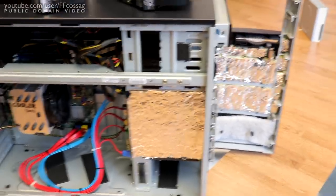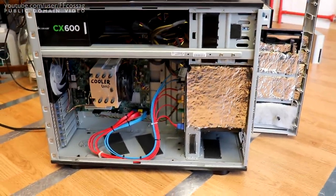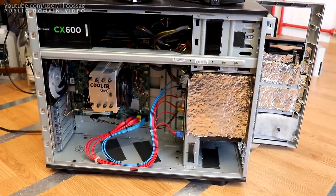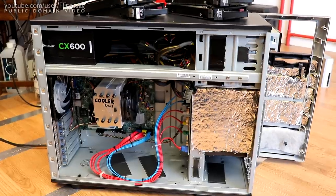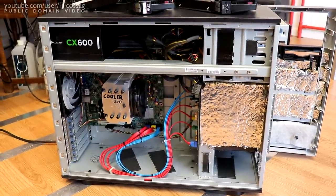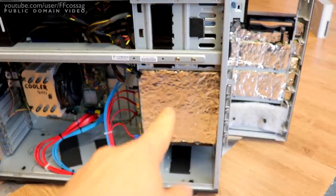However, with five drives plus an SSD we are going to require some hard drive cooling. The WD Reds run at about 45°C in normal operation — that was with minimal airflow — and I don't want to risk running my drives over 50°C, which is certainly going to be the case when we add four new drives. So we basically have to undo a bunch of this soundproofing.